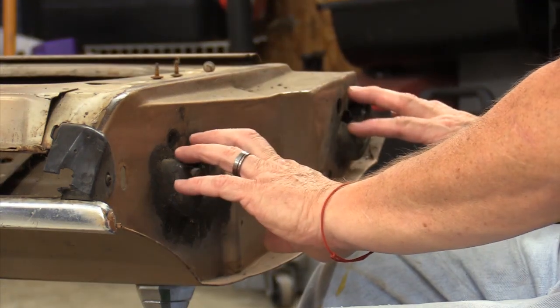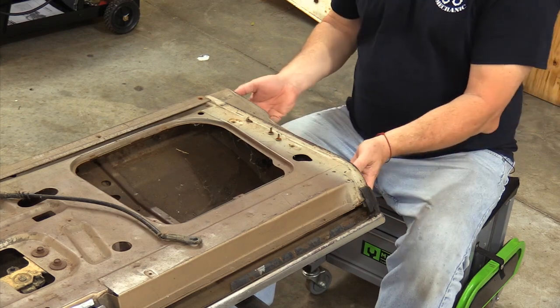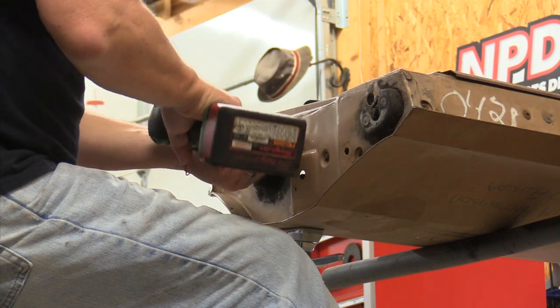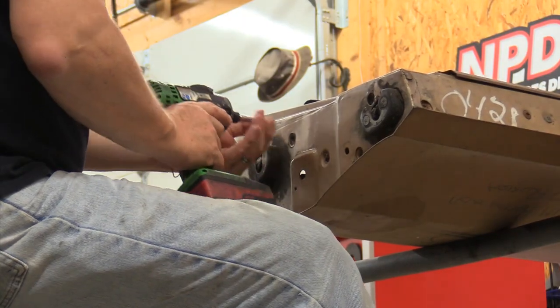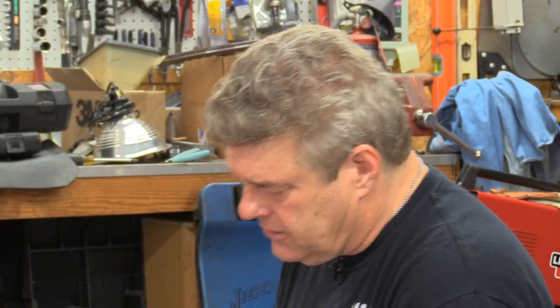Next I'm going to take off the two bear claw latches on the very end of the gate. All this needs to be cleaned out and I'm going to hit it with some sealer. These have to come out in order to clean that up. I've already got the stuff off the other end of the gate because it's a little easier since it's bolts. But because we have screws here, getting that screw to come loose is going to be fun. I'm going to try hitting it with an impact driver - this is an old Snap-on. All of them will hit at least once. If it doesn't take, I'm not going to keep banging on it. The passenger car screws are a little bigger and fatter than these are, so I'm going to make sure I hang onto these, bag them up and keep them around.